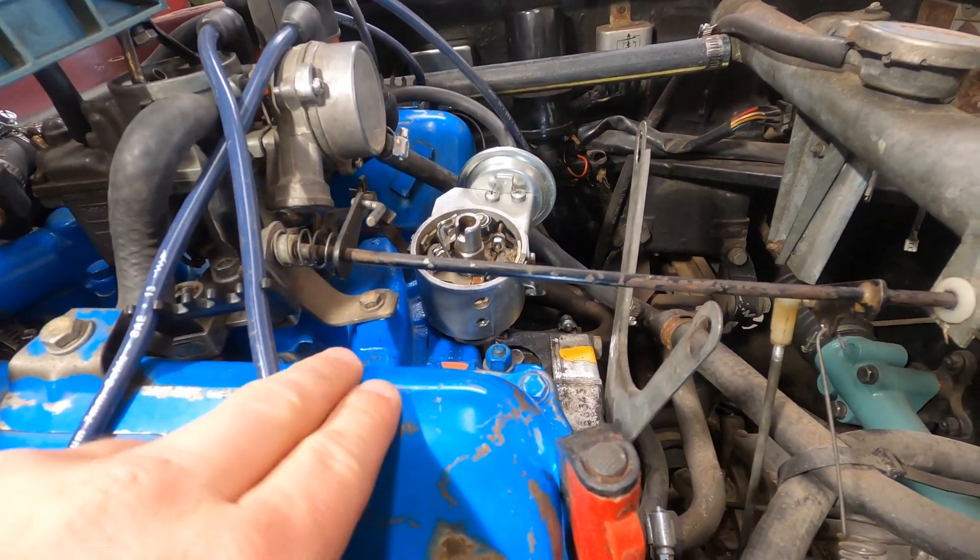I know what you're all going to say — I've heard it on forums and Facebook — I'm not doing Pertronics. There are two reasons. Number one: I enjoy the mechanical aspects of a car and when a system breaks I want to be able to fix it. Pertronics is not a fixable thing — it's a proverbial black box where you have to replace the whole box, which is a hundred dollar box. The second reason is that hundred dollar box does not fit the distributor I got rebuilt. So I'm going with points. Maybe you have a car that Pertronics is really expensive for — a hundred dollars to replace a ten dollar part is pretty expensive.